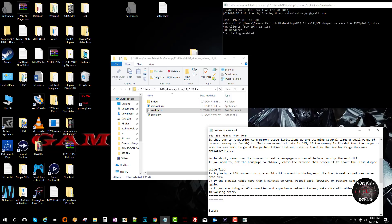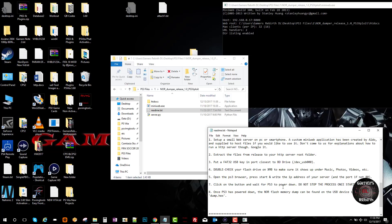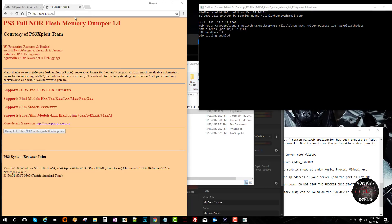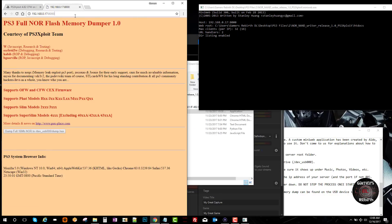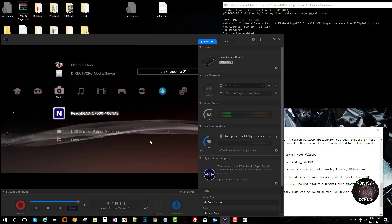Make sure you have a wired connection or a strong Wi-Fi connection. The exploit should work within about five minutes. Really important: have your USB thumb drive formatted as FAT32 and inserted on the right-hand side of the PlayStation 3. Now I launch my browser on the computer — make sure you type the IP address it gives you: 192.168.0.17, then port 8000. You will get an alert — it might look confusing — saying you don't have a PlayStation 3 system or something like that. Just click OK.